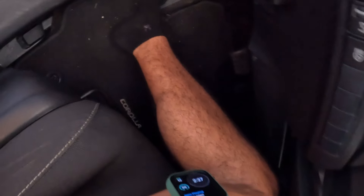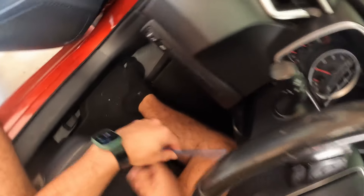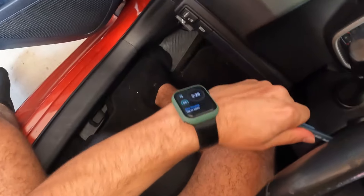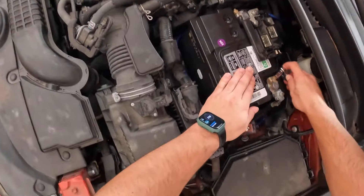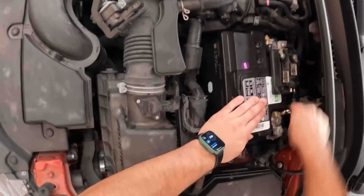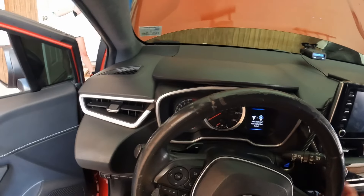There's going to be three holes you're looking for right here. The best way to do it is grab a pin and just shove it in there. You're kind of looking to feel like a pin, but you're just pushing on it, fishing it in and out until you get that front airbag to kind of pop out at you. There are three that you're going to have to stick the pin in to get access to all the pins for the airbag to loosen up.